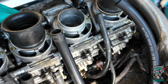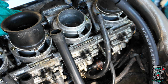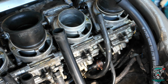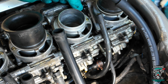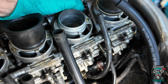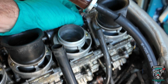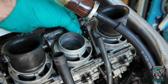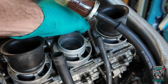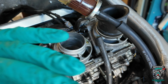And then I think it was leaking from two places, wasn't it? It was running down the side of the engine and out of that pipe. This little angled T-piece thing here, go up a bit with the camera. God, I'm such a good cameraman, it's incredible. Yeah, this little plastic T here doesn't seal very well, so I think it's leaking externally and down that pipe.